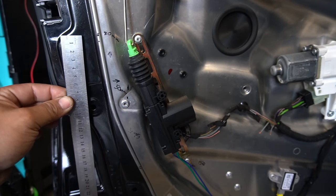You need to put the aftermarket locking pin through the single hole first, then after bending it to where you want it there is a screw to tighten. I like to secure the fastener to the aftermarket locking pin first and then secure it to the factory locking pin. Also, in order to reach the locking pin you'll need to cut open the rubber grommet — do not remove it completely as you still need it. Make a little slit, get the fastener in there, and tighten the screws so it grips firmly onto your factory locking pin.